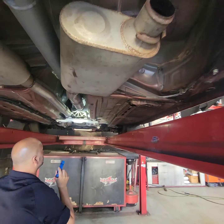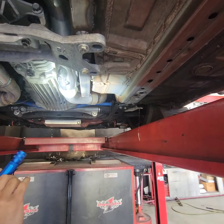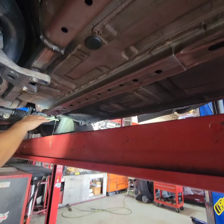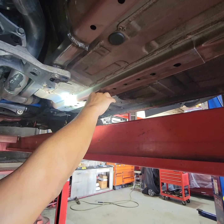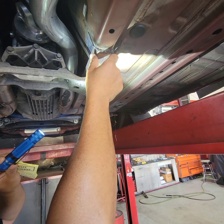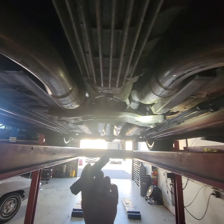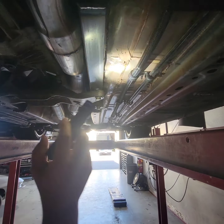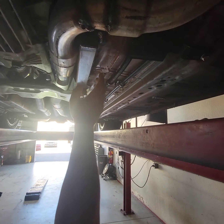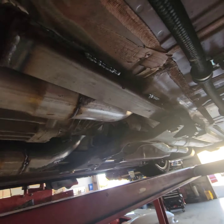The other big thing is there's some stuff they did that's a little rough. The cage and all the track day stuff up on top is pretty good, but when they did the swap it looks like they did it quick and dirty. Instead of properly going to the subframe right here for the cross member, they just used a stock Mustang one and scabbed in a couple of one-and-a-half by one-and-a-half square box tubing sections. If you look in here, it's not fully welded — the way they integrated it is maybe not the best. At minimum, since it's a track day car not a show car, we should go through and make sure it's all reinforced and up to the task.